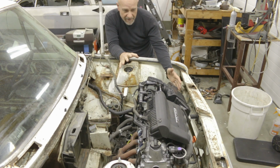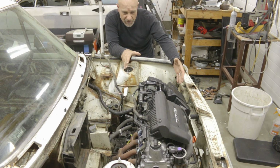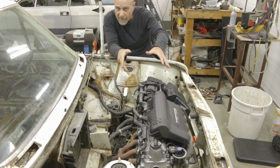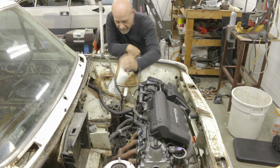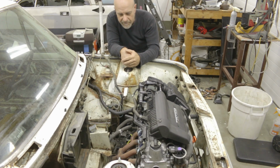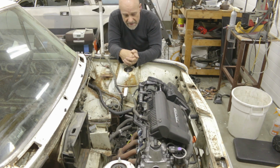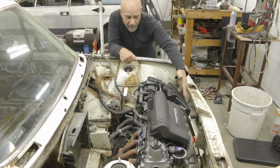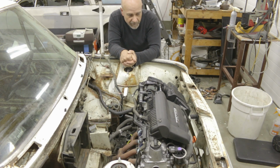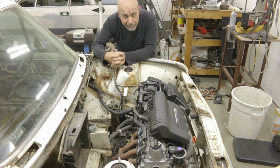would probably be to just take this engine as it is and, around the center line of the crankshaft, just kind of tilt the engine back about maybe between 5 and 10 degrees. And what that will do is that will free up space in the front and space in the back. And it will still make the exhaust even tighter. So I'm going to have to take that into account when I modify that. But that should buy us pretty much all the space that we need. And also it will free up a little bit more space from the front of the engine where it would be close to mounting behind the radiator. So that is kind of my quick solution to that.